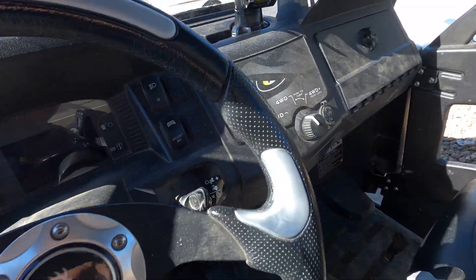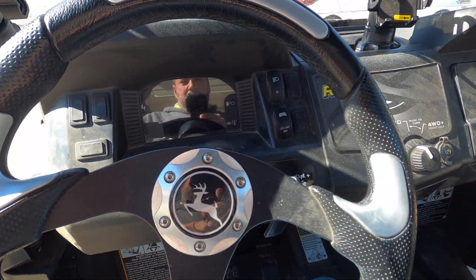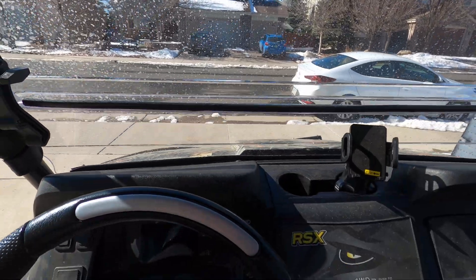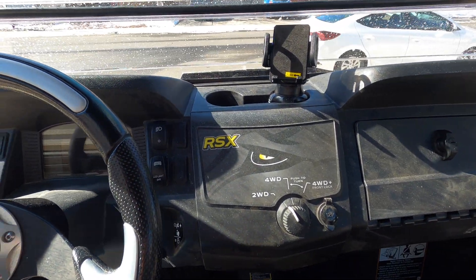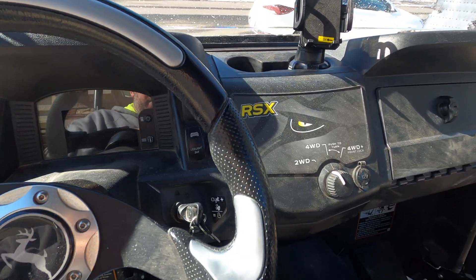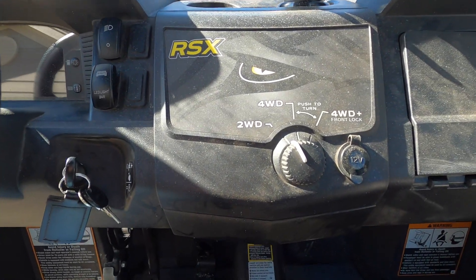Today I'm going to show you a minor upgrade we're going to do to the Gator. One of the issues is that when you have a snowplow on the front and you're using the winch, it draws current from the battery. I also have a bunch of lights, so when you're running all of it, it's not hard for your battery to run out of juice. The alternator doesn't really keep up unless you're running the engine at high RPMs, but the problem is there's no voltmeter — so we're going to add one.